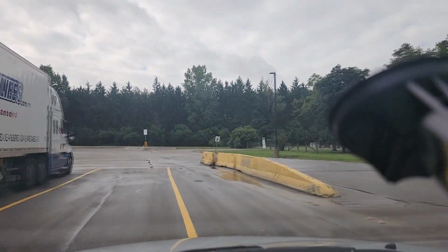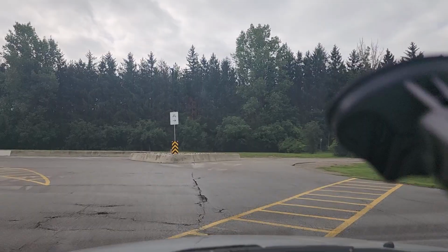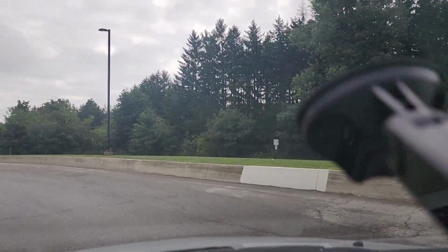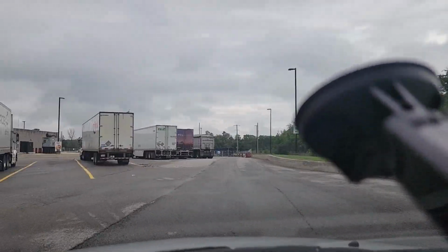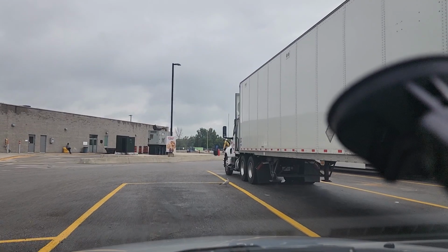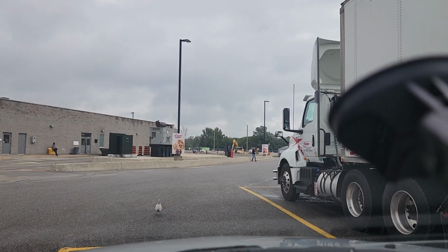So what I can do right now to kind of remedy that is I'm going to pull the outboard out of the V-berth, put it in the car. That's about 50 pounds off the tongue. I got the gas can up there as well. It's about 25, 30 pounds of gas. Like we're almost right on the tongue. I'll take that out. And what else do I got in there? I have a 5-gallon jug of water, but that's sitting closer to the axle, so it might be okay.